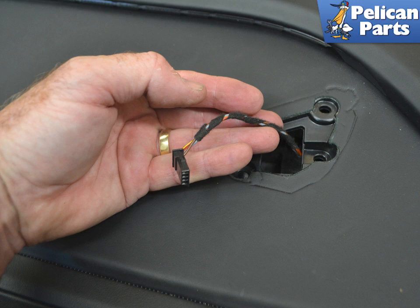To teach the end positions, reinstall the door panel and start the vehicle. Pull the rocker switch until the window is fully closed. Then pull the switch again and the upper position is stored. Press the rocker switch down until the window is fully opened. Press the switch down again. The position is stored. You can turn the car off.